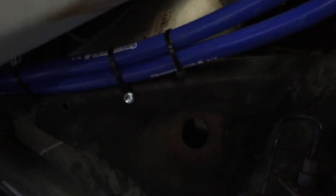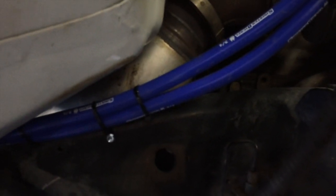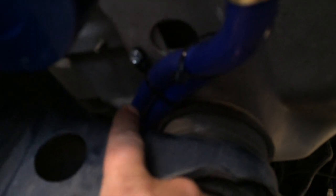You can always cut the hoses and loop them together to take the whole system out of the circuit. I'll probably end up going over and getting some rubber hose and putting some anti-chafing hose around it so I don't have any problems down the road. This isn't a daily driver - I only use it to tow my trailer going out to the desert and Glamis, so I don't want it to break down a couple hundred miles from home. These zip ties with a little eyelet are pretty handy - I just tech-screwed it to the frame rail to hold it in place while still allowing a little movement. Then ran them down here and we crawl underneath - it runs just on the other side of this body mount and up into the filter head.